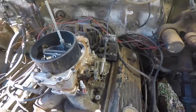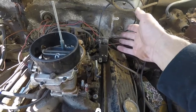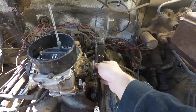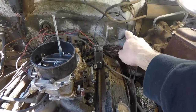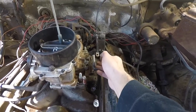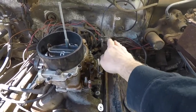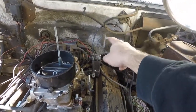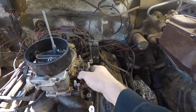I don't know if it really means anything, but I thought maybe the cable was old or bad and needed to be replaced. Sometimes I've read that if the cable gets old it can have a lot of resistance or be tough to move. So right now it's obviously not connected to anything except the accelerator pedal inside the cab, and this is very easy to move. You have more strength in your hand than your foot or your leg, and I don't feel like there's any resistance. I don't think there's anything wrong with this cable other than maybe it's a little bit too long. I feel like the problem is all right in here somewhere.